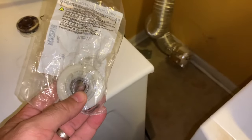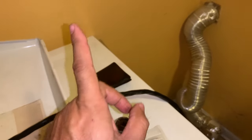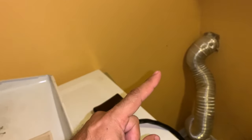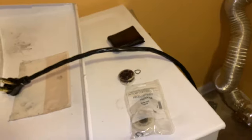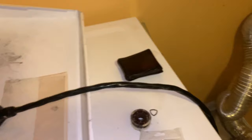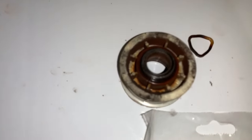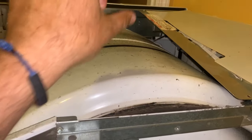I'll show you at the back where it goes. The tensioner has a switch at the back which is in series with the motor — if the tensioner switch is not satisfied, it's the same as the thermal switch not being satisfied. So there are a couple of places you have to look for opens.